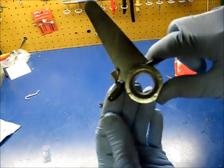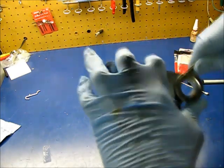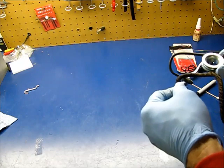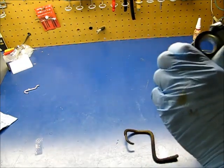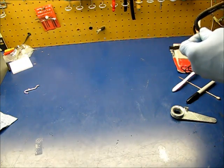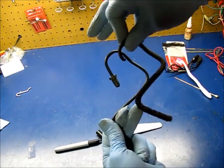You kind of have to do it any which way you can. So I'm holding the nut on the bender like this, bringing it back, checking it — that's going to be pretty good. Using this as a template, mark where you want the next bend to go. I've got the bender going this way and line up my marks. So here we are with the first bend for the rear. We're going to take this out to the car now.